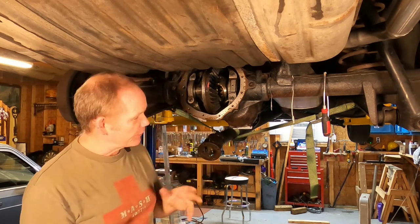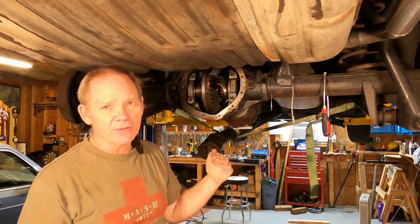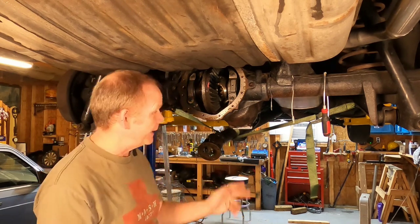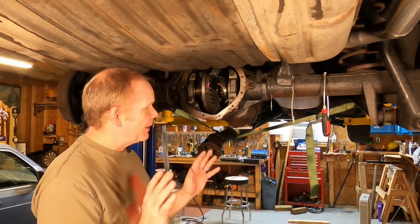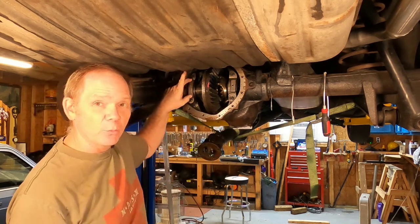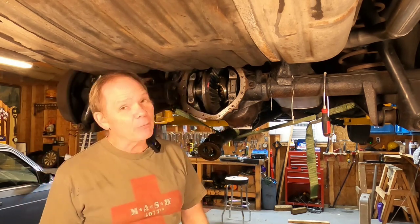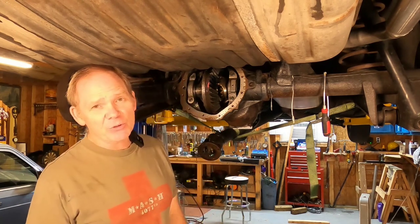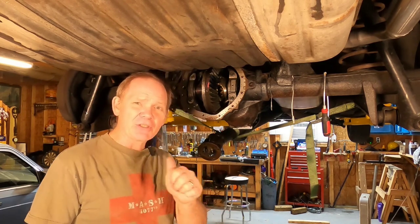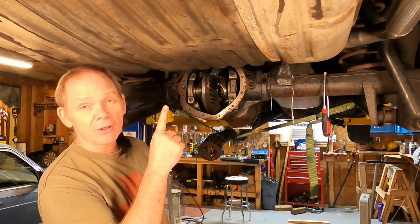That's the update. I've spent the last three days trying to figure this thing out. With this new configuration, the pinion depth was just off the chain — it was so deep into the differential that nothing would work. I was dumbfounded. Anyway, that's a long-winded answer for an update. I'm currently waiting on parts from eBay and I'm going to experiment with trimming down this shim to fix the backlash, because clearly it is way too tight. That's all for now — I appreciate you guys stopping by the channel. Don't forget to like, share, and subscribe. If you'd like to be notified whenever I release a new video, click that little bell below. You guys have a good one. Remember to enjoy driving, maintaining, and restoring your classic Cadillac.